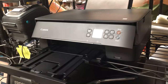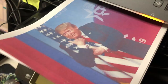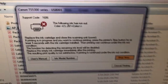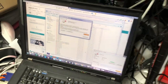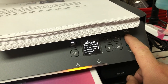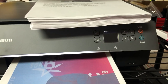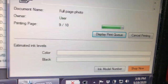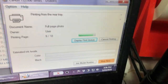Now we just run more pages until the color ink level odometer runs out so we can turn it off — 589 pages. Remember what to do: do not close this window. Come back here, find the stop button, click and hold for 5 seconds. You're going to see that window disappear while you're holding it. You hear a click and the printer is back to work. If you check the estimated ink levels, both of them are blank now — the printer will not keep tracking ink level anymore.